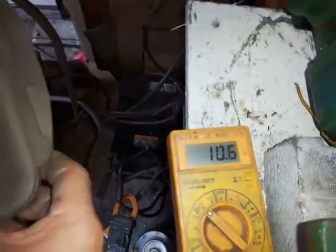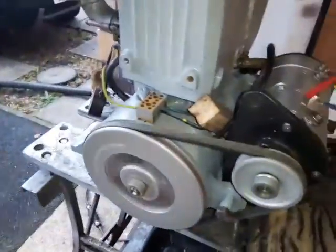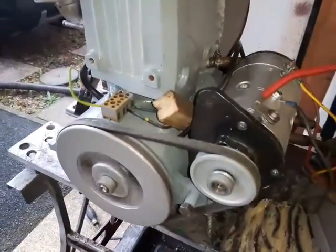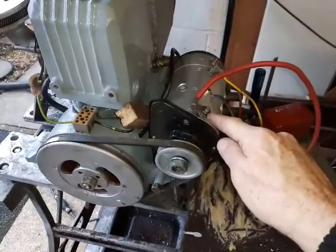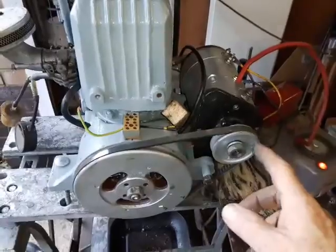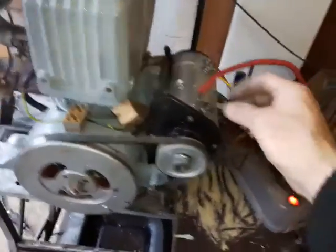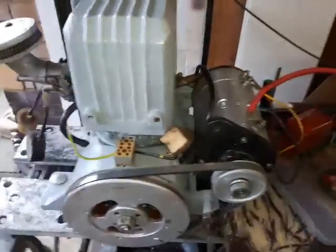It's now cranking over — it's 10 volts — but it's still able to turn the engine over. That's the test. So if you have got more than 10 volts on this terminal and it's not cranking it over that fast, then there's something wrong with the Dynastart. But if you have got 10 volts, then you should be getting that sort of performance.